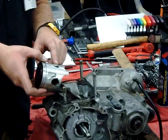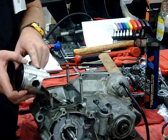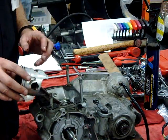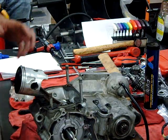Notice here that we had a reed intake motor. What did we notice about the piston now that we have it apart? It's also a piston port and a reed — that's where we have that hole in there. We could disassemble the piston right now if we wanted to, but we're not going to worry about it. We're focused on just splitting the cases and then putting it back together.